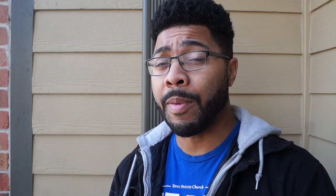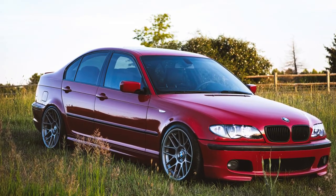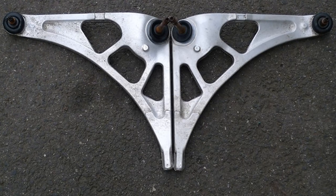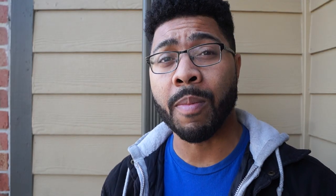Let's get to the point of today's video: the E46 M3. Not to be confused with the Sport model from the E46 variant — the 325 Sport, the 330 Sport. The E46 M3 has its own suspension geometry specifically for itself. It has thicker control arms, a different offset for the strut mounts, and that is exactly what today's video is about.